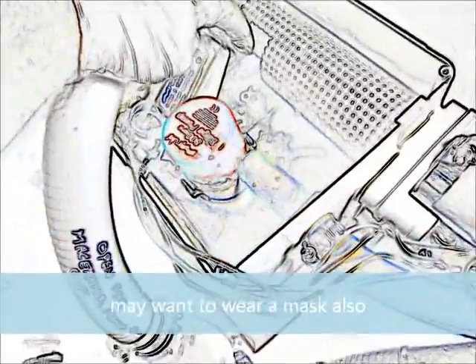I got the lid off. I put on some rubber gloves and cleaned out the pump a little bit from some hairs and things, and put them in the trash can. I found out that the float switch is actually working. We need to clean this out and see if we can let it last a little longer. In order to clean this out we're going to take this screen out of here.